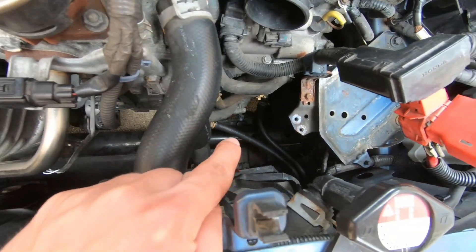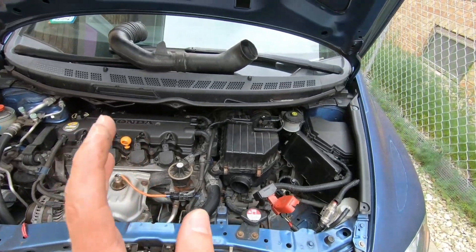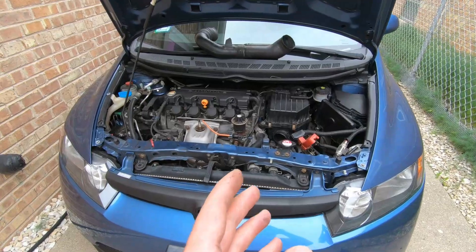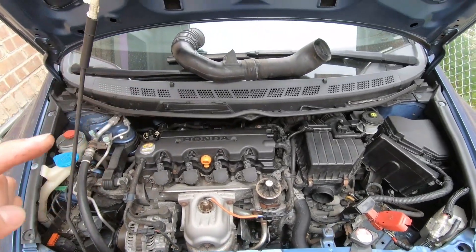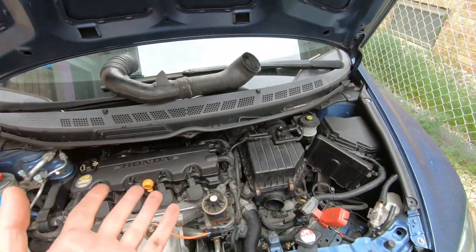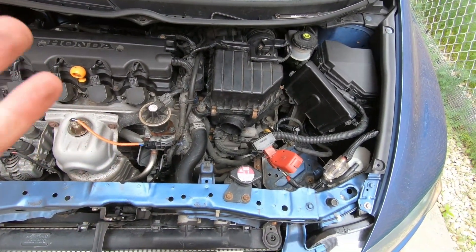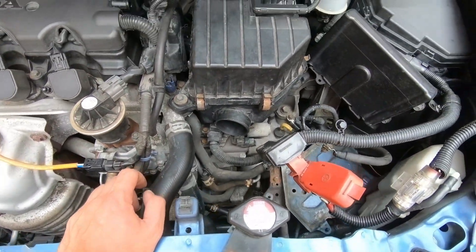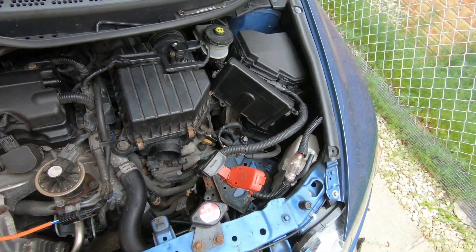Speaking of temperatures, these are my transmission cooler lines. I recently installed a transmission oil cooler, replaced the transmission fluid, and replaced the inline transmission filter. I noticed the transmission shifting better. I also had a problem in third gear around 6,000 RPMs — the RPMs would climb, hit about 6,100, fall back down for about two seconds, then climb again. I couldn't figure out if it was air-fuel ratios or knocking, but after doing all this the problem for the most part went away. The cooler transmission temperatures and the free-flowing filter probably had something to do with it.